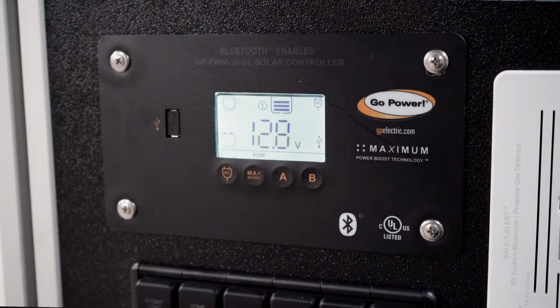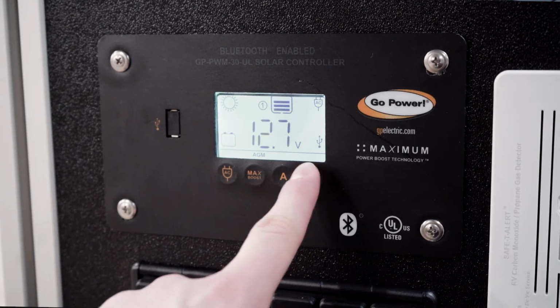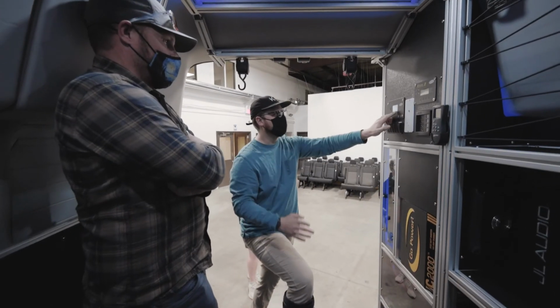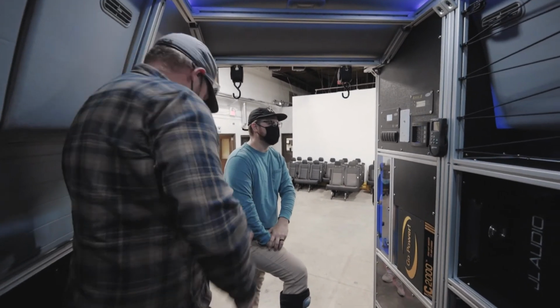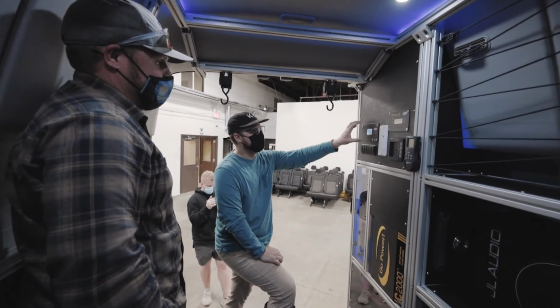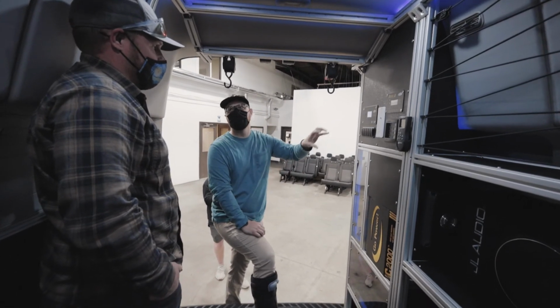This is a rough percentage of that voltage range I was telling you about, where 11 and 12.8 is that 0 to 100. And then the last one is just cumulative all-time added amp hours, which is reset by downloading the Bluetooth app and clearing it. So really simple controller. I'm sure you'll have fun pulling it out for maybe Renogy or something. I don't know what you're planning on, but the controller is integrated into the back side of this, so it's just one unit right here.